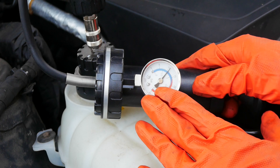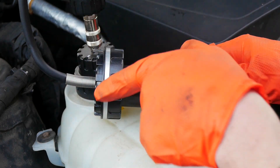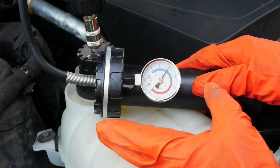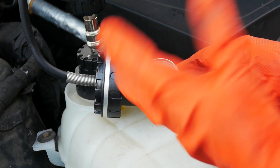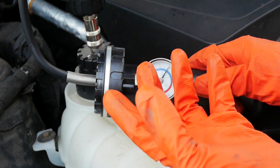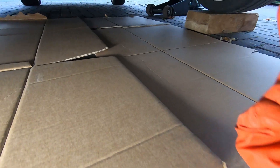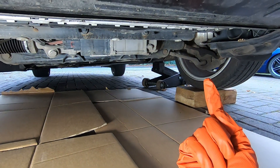The pressure does drop a little bit on my tester because somewhere in the system the air leaks out a little bit. But while it's pressurized we can jump underneath the car and see if we see any water landing on that cardboard. If there is a leak, normally you would see it start dropping down onto the cardboard somewhere, and that gives you an idea where above you it's coming from.